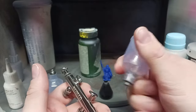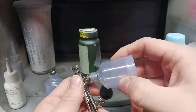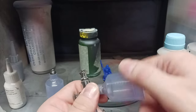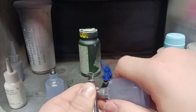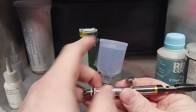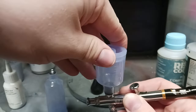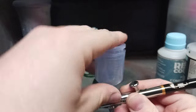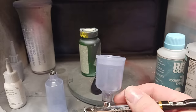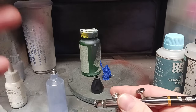For this you have one that's a little bit taller, has pre-measured lines on it, but still has the metal threads. Just screws in — hand-screw all this. Don't overly tighten it. Get it tight though where it's not going to leak. And now you have all this room compared to the original cup to use. You've also got a little lid, which is nice because then you can prevent spilling. The metal would come with a lid too, but you're rarely going to use the lid on your metal cups. It comes in handy for a variety of paints — usually lacquers, some metallics, or some heavier paints.